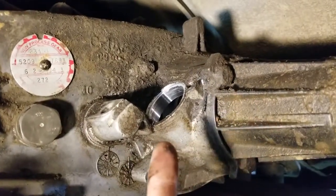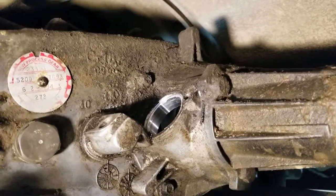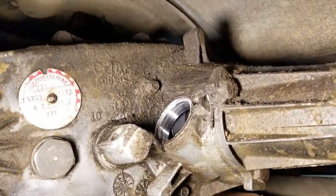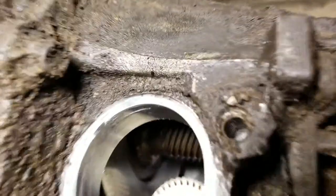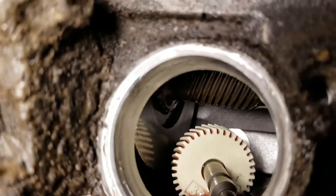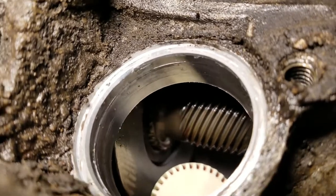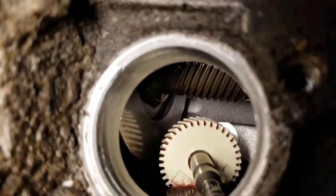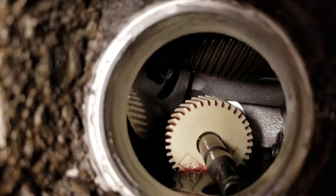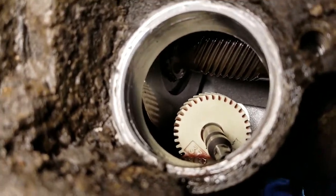Now, my Speedo gear actually fell off inside of here, which I can't imagine that's common, but it did, so you're gonna get an exclusive look inside the transfer case. Let's see if I can get the light up there for you. Oh, jeez. Look at that. So, we've got ourselves some transmission fluid in the bottom. You got yourself a worm gear up here, and then that plastic gear, that is what's supposed to be connected to your sensor, but it's sitting in a puddle of fluid at the moment, which I don't fully understand. Anyhow, I'm gonna pull that out of there.